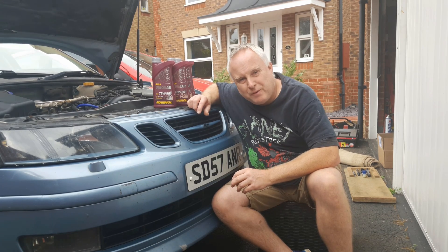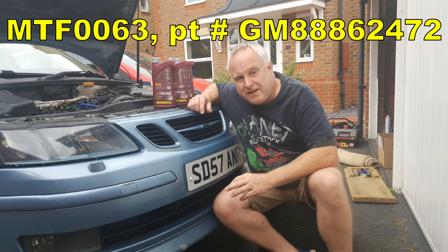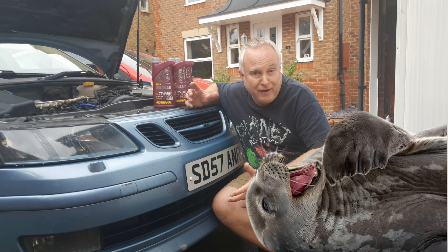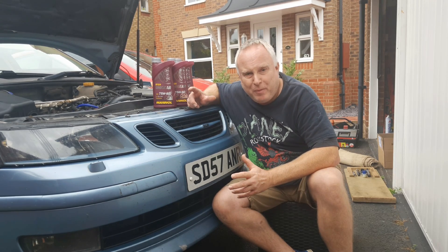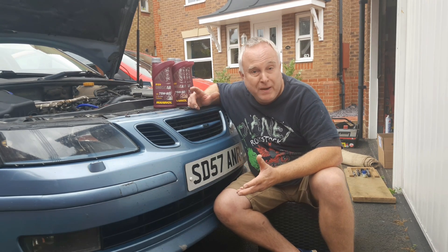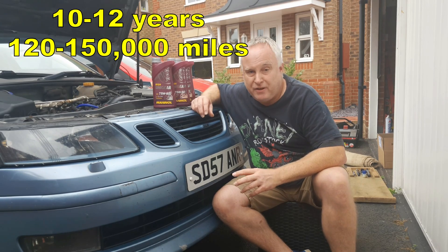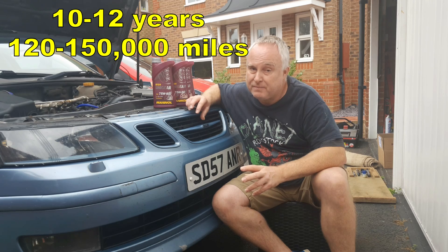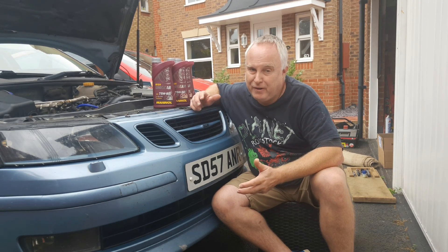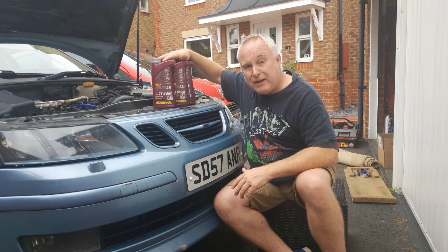From the factory, these boxes were filled with a Castrol-manufactured oil designated 0063 and no fluid change was specified — they are filled for life. Be under no apprehension that they will last forever without a fluid change, because the usual OEM definition of life is 10 to 12 years and 120 to 150,000 miles. About half of all boxes can be expected to suffer early-life failure before that point, so stack the odds in your favor by changing the fluid at regular intervals.